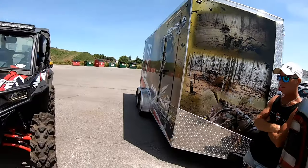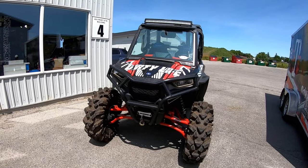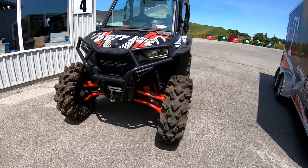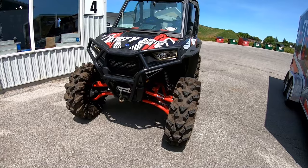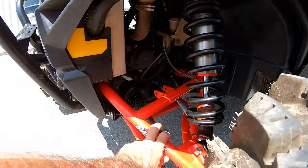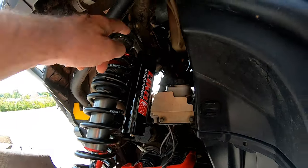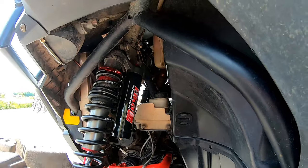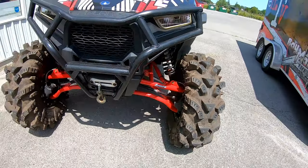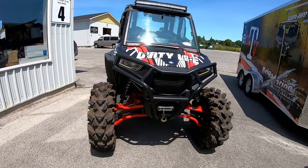You're happy with your 28s on there? Yeah it's ripping. We've always had the Super ATV forward offset A-arms. This year because we were changing the color scheme and I had thought about going to a kit for the front sway bar, the new A-arms have the mounting point for the front sway bar right here. I decided rather than powder coat and weld, we'd just get new ones. The bracket adjusts the shock mounting point and it does make the ride not quite where we want it yet.